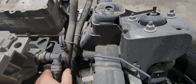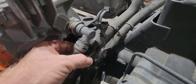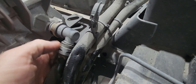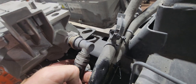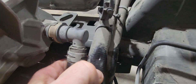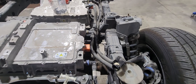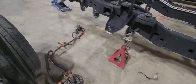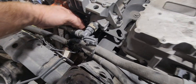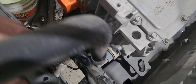Let me flip it. This line was laying right underneath here like that, and you can see there's a dent right there. That line has a clamp with a sharp edge right here — right underneath here. That clamp would eventually have gone through the hose. So if you've got one of these trucks, you might want to talk to your dealer about that. If somebody at Ford is watching, they need to change the orientation of this clamp — this sharp edge right here was digging into that hose.